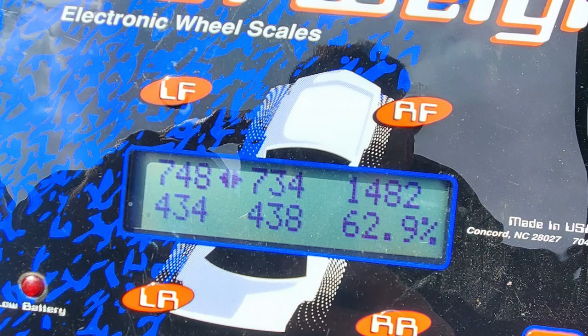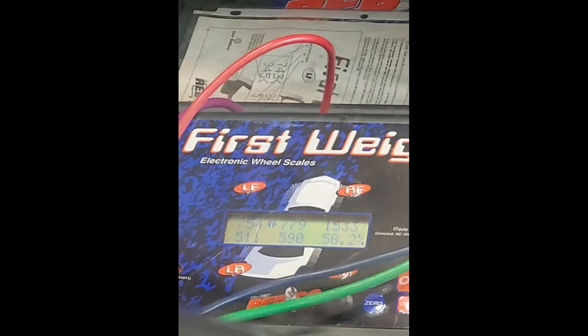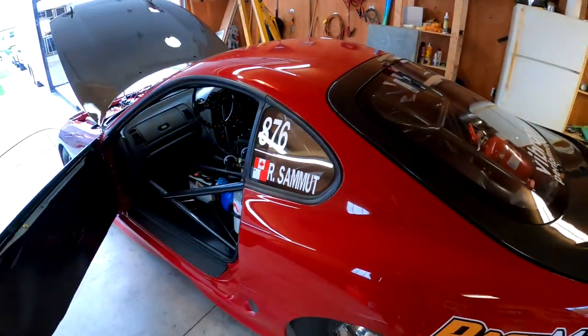So it's 62% in the front, which makes the rear kind of very light. I got big tires and I know it helps, but everybody's telling me that the front is too heavy and if I put weight in the back, the car will go quicker. I kind of trust Chris Delgado — whatever he tells me, I go with it. These guys have done it, they know what to do. So I put 80 pounds in the back, that kind of put the weight bias to about 57, 57 and a half percent. So now I got 57 and a half in the front — 40 pounds on each side.